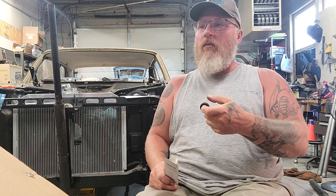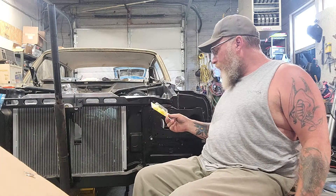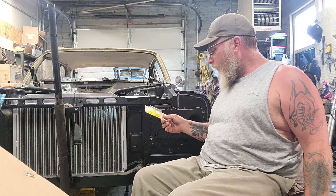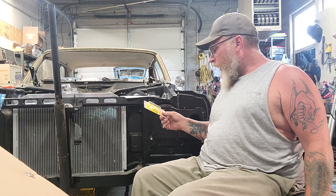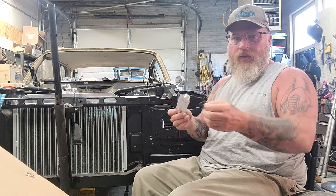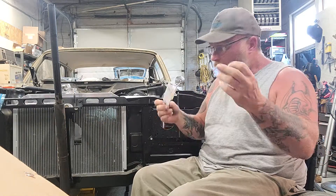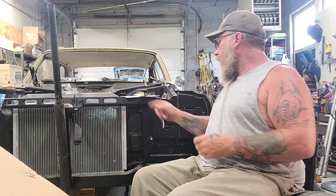The one underneath there is eaten up — you've got to really pull it up into park high to get the neutral safety switch to do its thing so you can start the car. It's frustrating working on old things, but we'll get it figured out. Even if I have to take a piece of rubber and epoxy the two together, I'll make it work.